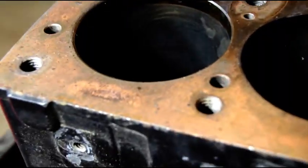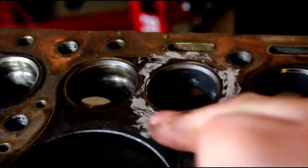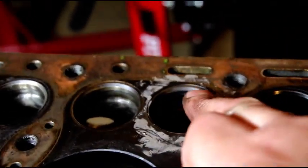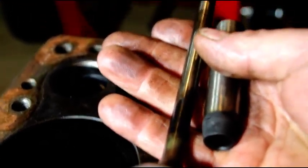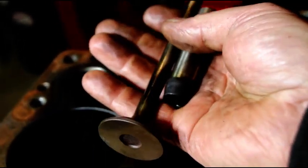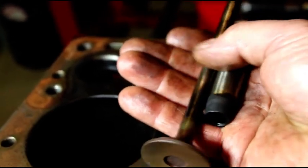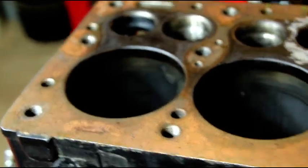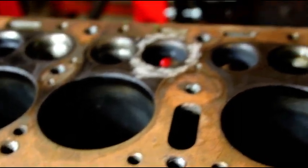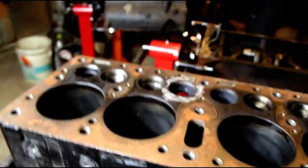You can see how it damaged the seat. The seat is damaged on this exhaust. There's also all that crazy sealer on here — I don't know what that's about. Every valve, every guide is worn. Again, this is a 3,000-mile engine — there was no normal oiling going on to cause this kind of wear. I believe the low oil pressure was killing this engine, and I believe that low oil pressure is directly related to a poorly cast engine block.